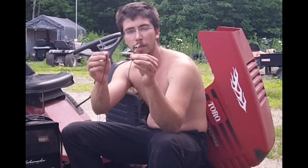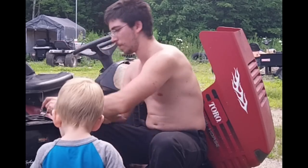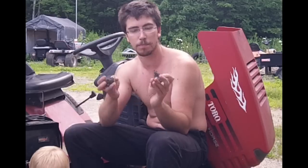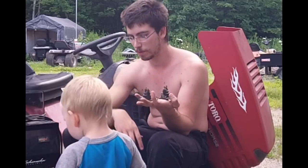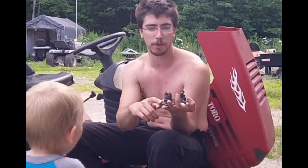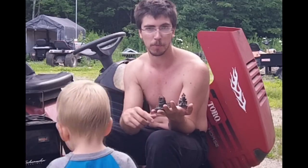The other thing you're going to need is just a regular alligator clip set. These are usually like $3 at AutoZone. And you're going to need a basic understanding of how solenoids operate. Now, there's basically two types of solenoids that you see when you're dealing with most of these. You have single pole solenoid and you have double, or rather four pole, three pole.